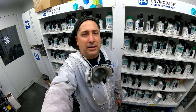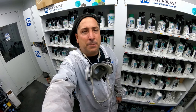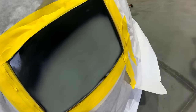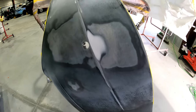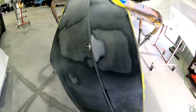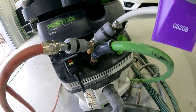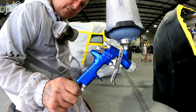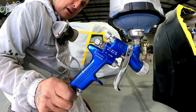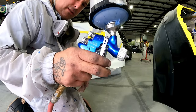To any of you guys out there using PPG, I'm sure you know this stuff, but it's definitely a very good product. Let's go ahead and prime a couple little parts and I'll show you how nice this stuff is. Here's the spot we're going to prime — just the end of this quarter and this spot on the bumper. I like to use the 1.0 tip with this stuff because it puts down a small droplet and lets it dry quicker. This small Pro Light gun works really nice.